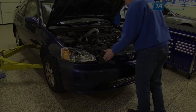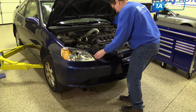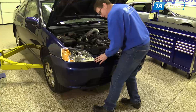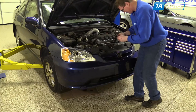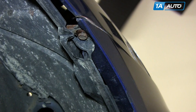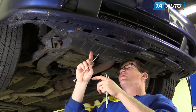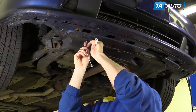Put the bumper cover back in place — make sure you go underneath the latch lever and align with the headlights. Put the clips back in to hold it in place. Reinstall the 10mm bolt on each side. Once the bolt is back in, push your inner fender up and in. Some clips may be missing — use wire ties to secure the bottom if needed.